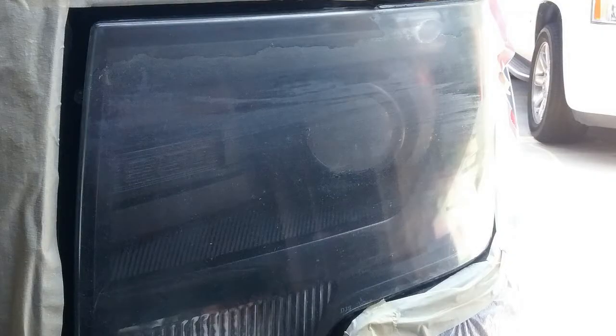It'll be frosted and chipped at the top, but you'll see specks of the defects in the rest of it. You got to take the whole coating off, and then you have to apply clear coat to it. And so if you're not ready for those situations, and you think you can service it just like you might do a regular polycarbonate plastic that yellows, you're going to be in for a treat.